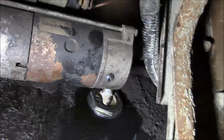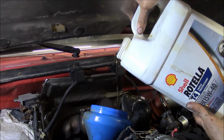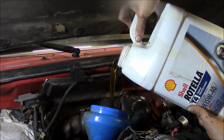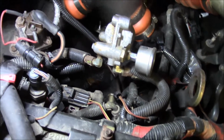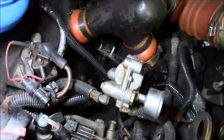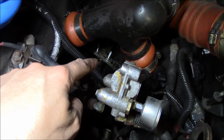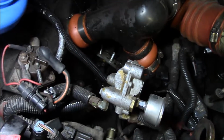Okay guys, starter motor's back in, and I'm ready to put the truck back down on the ground. Well, kind of hard to say on the fuel leak. It's definitely coming out of the valley. You see down in here, there's a couple of hose clamps on this steel line, and I tightened those up quite a bit. I think that was probably the main source of it.